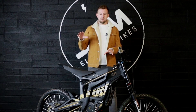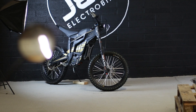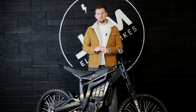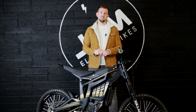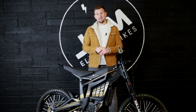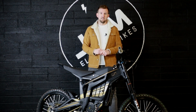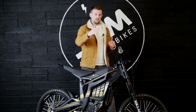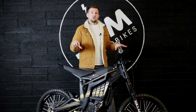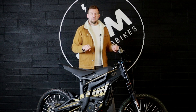You've got a seat height of about 870 millimeters, so for me at five foot nine that's pretty much spot on — I can just about get both my feet flat on either side once the suspension is compressed. It might be a little difficult if you are shorter, but anything up and above six foot will be absolutely fine. The handlebar width is 760 millimeters, which is a really good width to give you good stability under low and high speed.